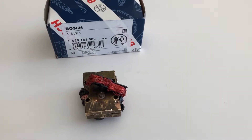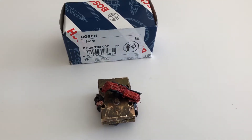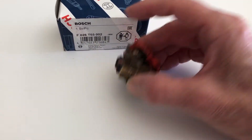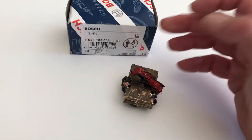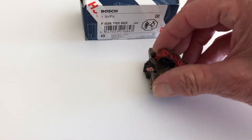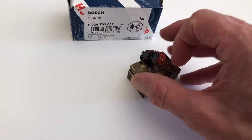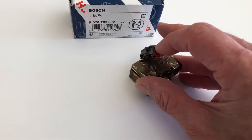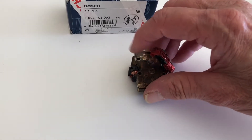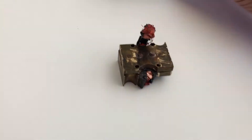Here we have an EHA valve — EHA stands for Electro-Hydraulic Actuator. I've cut the plastic cover that this thing is surrounded with; it was not easy. It's made by Bosch. These are used in a lot of 90s Mercedes, Volkswagens, Volvo I believe, and a dealer told me BMW also uses them.